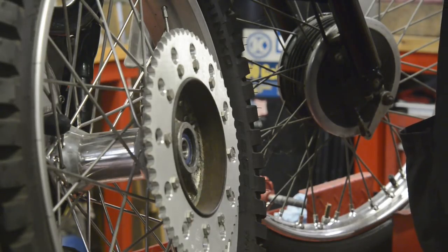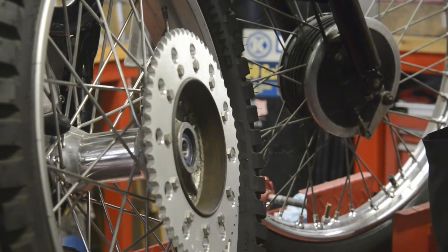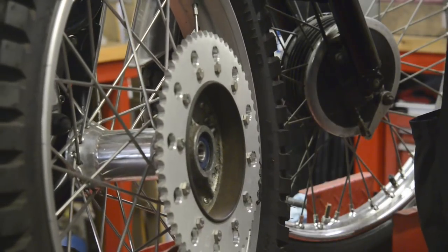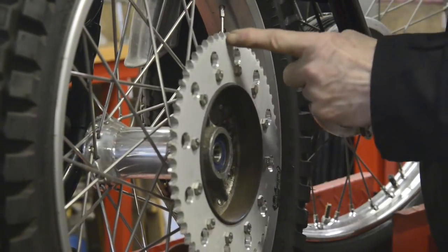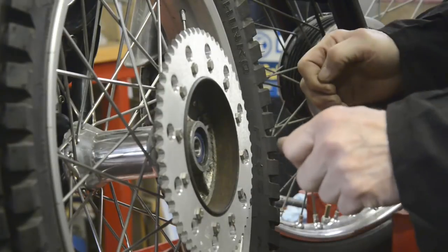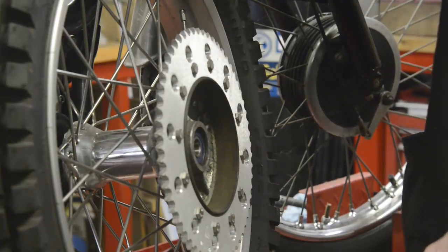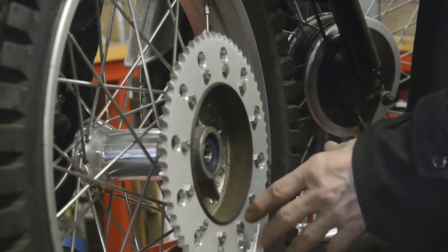God, this is a long time ago, when I used to go to Croft near Darlington to watch the road racing on the old Air Force base there. And a lot of the lads there who rode at several different short circuits needed different gearing. In order to save time, they'd have two or three different lengths of chain and the sprockets would be split. So that all they had to do was take the bolts out and the sprocket would come off in two pieces, go back on. They didn't have to take the wheel out and dismantle the brakes and all the rest of it. Well, you can't really do that if you've only got about four bolts.